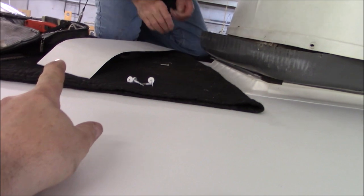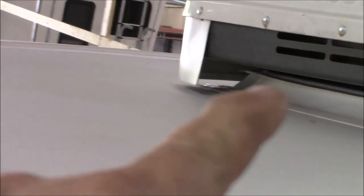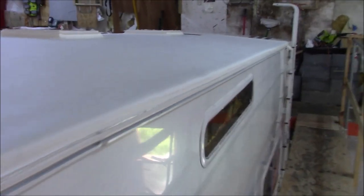You may be saying, wait a minute, I thought we were done with this video. If you look at the first clip when we started doing this, what I noticed was this counter flash piece was too close to the roof. I didn't like it — I figured if there was any vibration, I didn't want it to kind of hit along the roof. See the gap underneath this one? That's what we should have — the nice gap underneath there. All we needed to do is go below the flashing on the curb. You can see the gap underneath here — that's what I'm talking about. So when I went around and did the video, I didn't like it. So it's take it apart, do it right. That's what we do here — we do it right. Take it apart if it's not done right. There's only two ways to do things in this shop: it's right, and again.